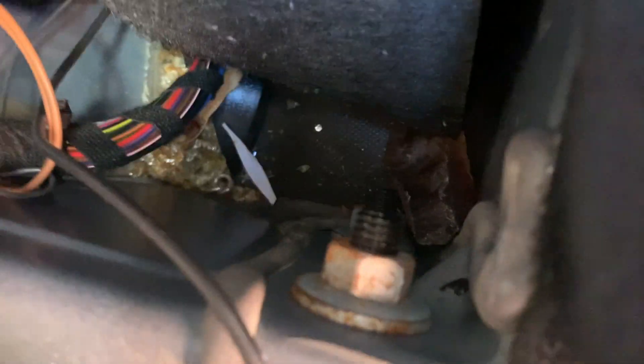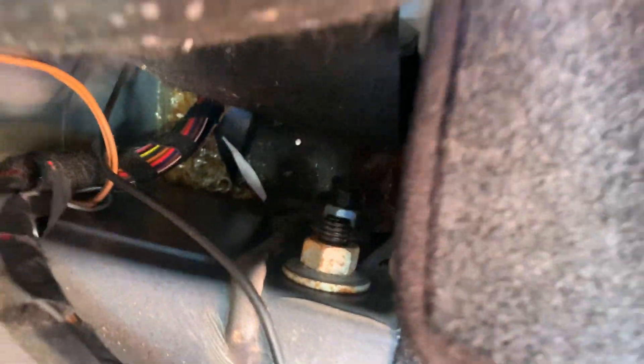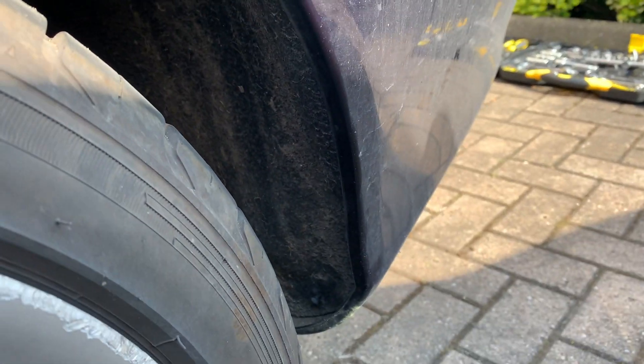I'm going to take them out to test whether we need to remove them. There are also bolts near the wheel arch. There's one right under this cover here, but I need to remove the cover first. This is a 10 millimeter screw — you need to get it from that bit there.